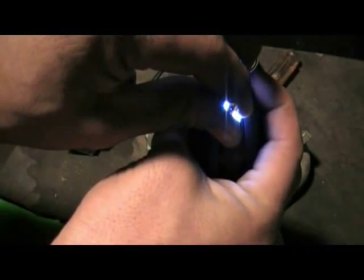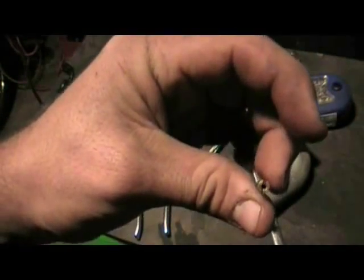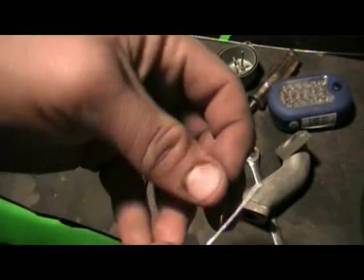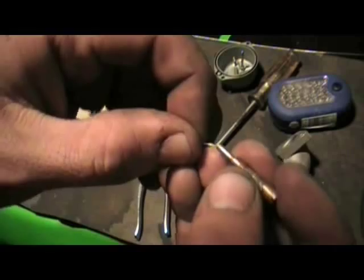This one has an extremely tiny hole in it and is very difficult to see through at times. If you have one that's jammed up, it'll have much smaller sprayer holes plus a much smaller hole in here. I found a neat trick to this: if you have a piece of bicycle brake cable — a little braided steel cable — you can cut off a little bit, take a single strand of it and pull it off, then feed it through the carburetor. Since it's all twisty, it's going to clean as it goes through.